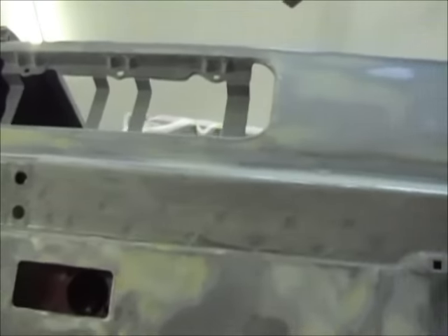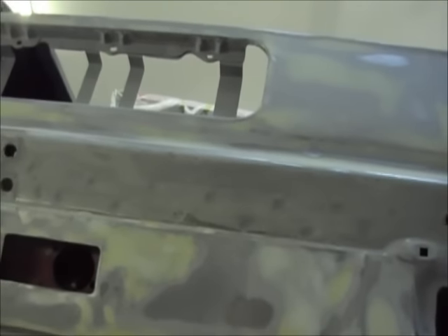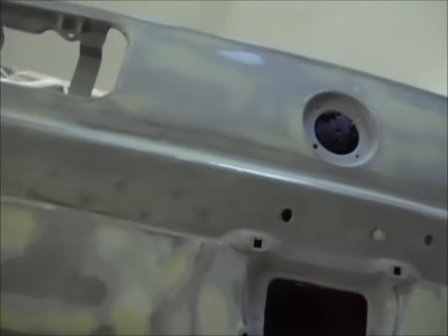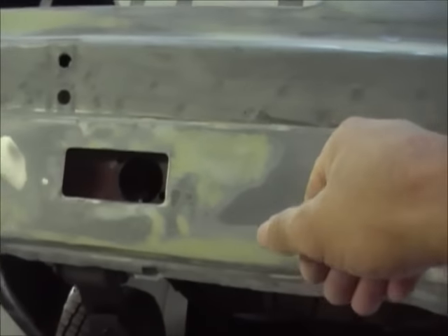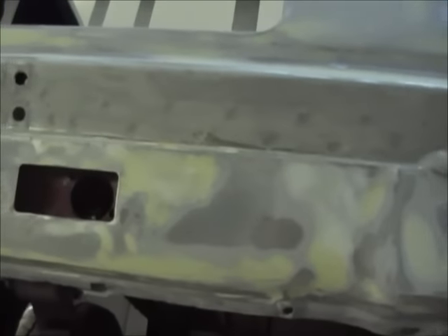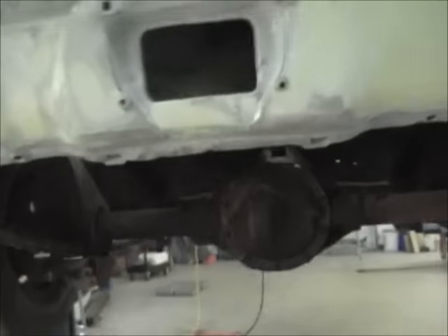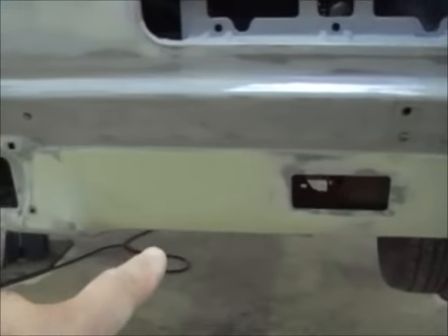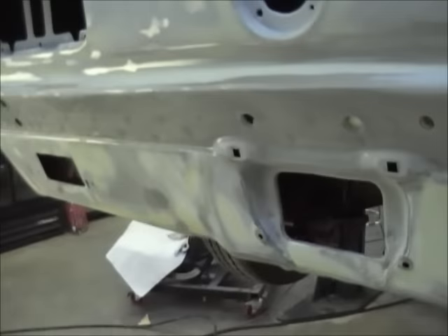I have to spend a little extra time — I have to kind of redo this area here. I'm happy with up there; I'll putty coat it and be good to go, won't have to redo any filler work up there because it's nice and straight. But this lower panel had been hit on the bottom — if you've been watching my videos, it was pretty messed up. I'm happy with where it is, I'm gonna leave that alone. I've got a couple of little low spots that I'll get a little bit of putty coat in, but other than that it blocked out real nice.